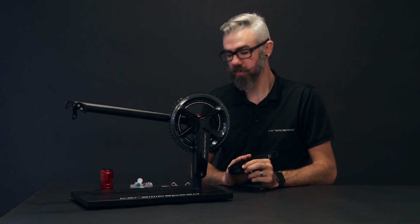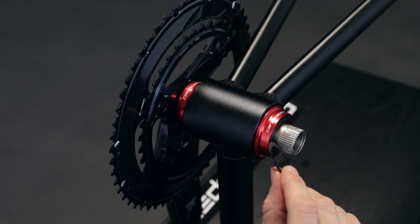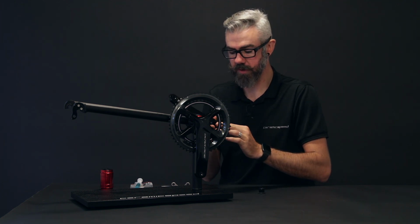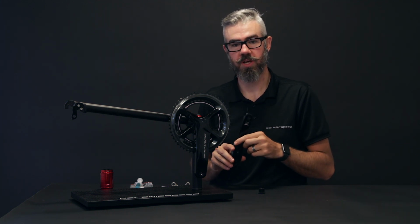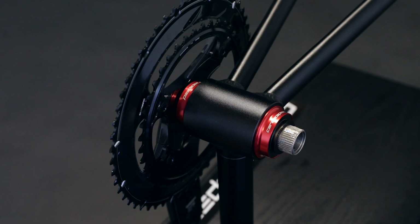We've seen with many of the 9100 cranks, one of the included 0.5mm dust covers going on in front of the dust seal and before the crank arm. Make sure there's adequate clearance behind the crank arm to the cup. It's always important that you check this before installing the chain and moving forward, to make sure everything performs at a nice level without scratching or marring.